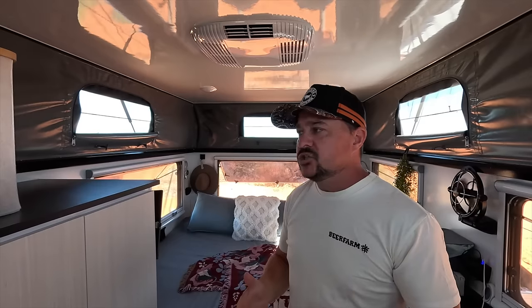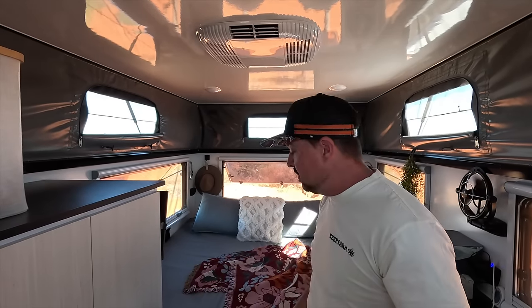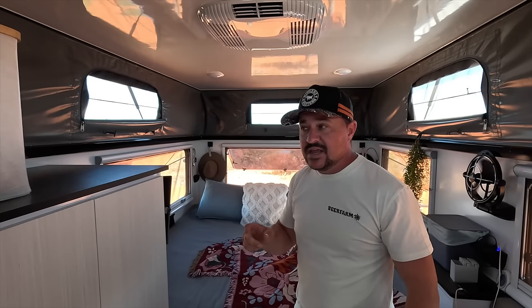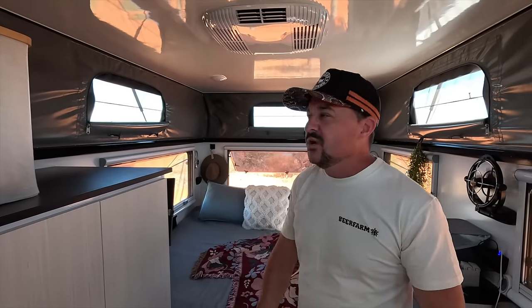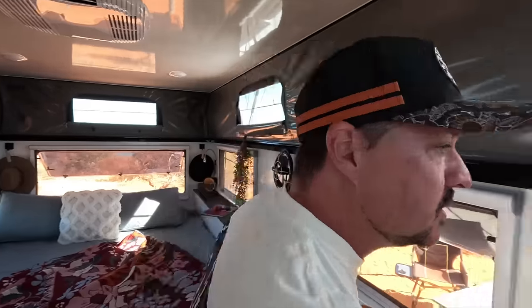So effectively, when you're traveling, you've almost got like 2 battery sources or 2 top-ups or power sources feeding your battery. 400 amps, when it's getting a little bit low, needs to be bumped up really, really quickly. So I love the layout of what they've got happening. Now this 3000 watt inverter, some people might think, well, that's a bit of overkill. 400 amp hours of battery if you're not getting off grid and doing stuff like we're doing all of the time, or not running Starlink and a whole heap of other stuff like that. People might say, well, why do I need all of that? I'll show you why. Watch this.